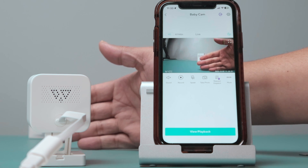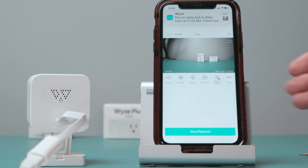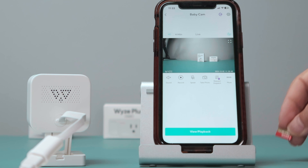It's working now. So basically that's the way it works: test your cable, power cycle the camera, plug into a different outlet, and do a factory reset without the SD card. Later you can insert your SD card again, set up your camera to record, and you're ready to go. I hope that helps — please subscribe to this channel, leave a thumbs up and your comments, and I'll see you in the next one.